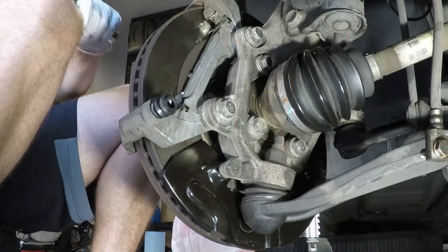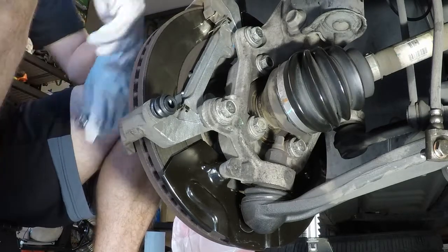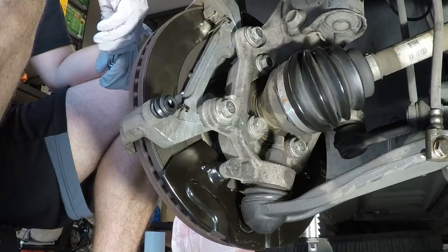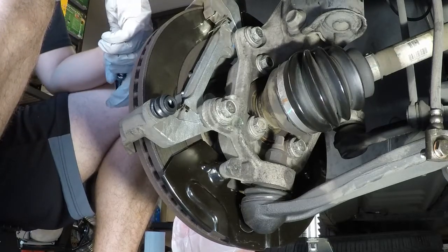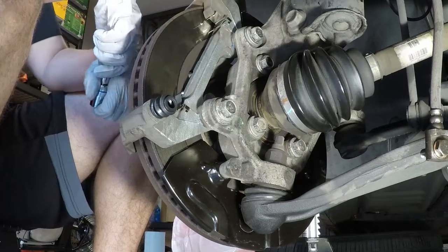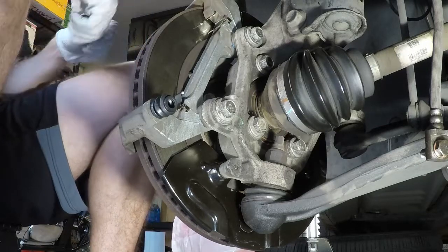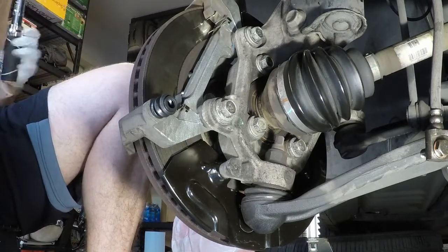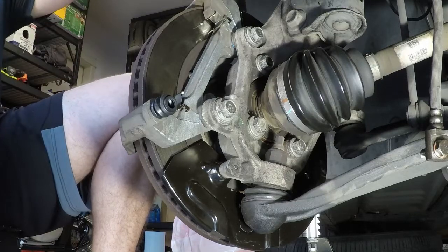And then we are going to need to torque those down. So those are going to be the caliper mounting bracket bolts for the front of a 2013 and later model. I've got those down as 122 foot-pounds. Yep, 122 foot-pounds. So let's see what we got here. 122.